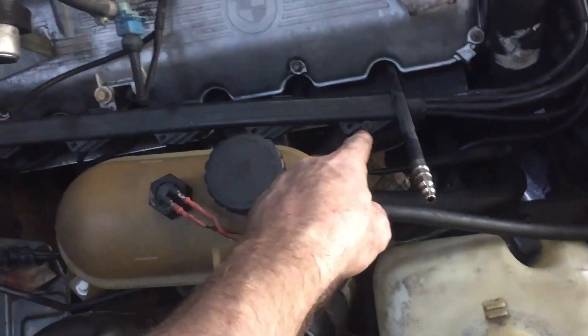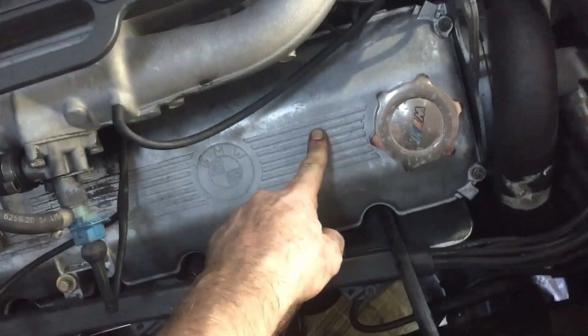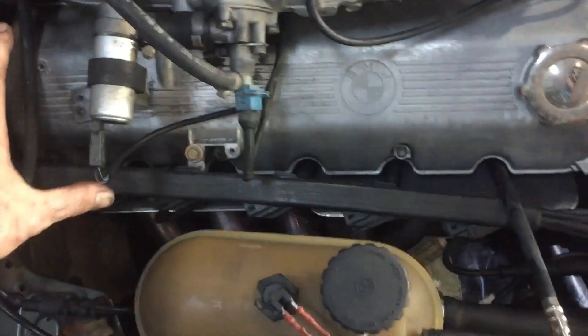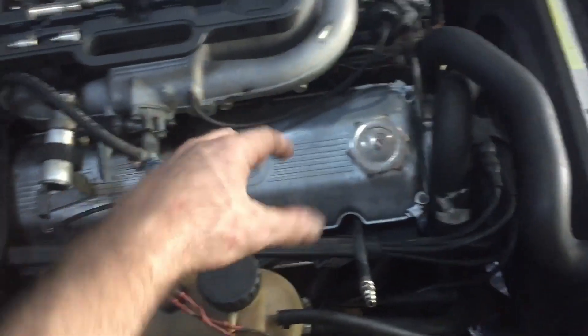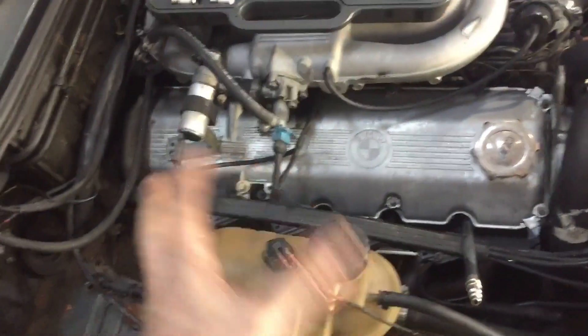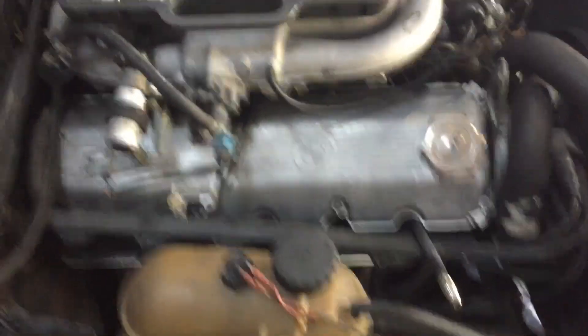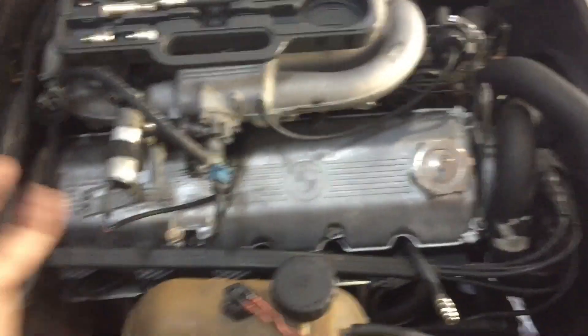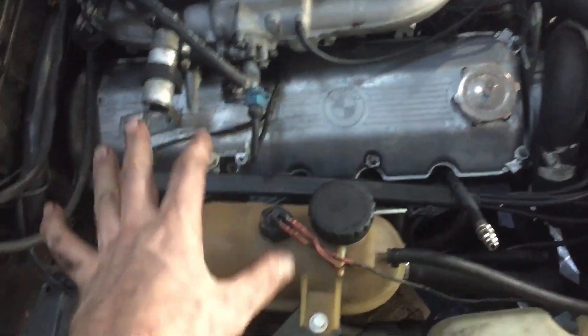You've got to take the manifolds off, take this intake off, take this valve cover off, and then take this long head off as well to get down into the piston and see what's going on. It could be the piston, it could be the ring, or it could be one of the valves that's stuck open. All of these have the same symptom. So it's very good to go through this engine and make sure that there's compression in all these cylinders.